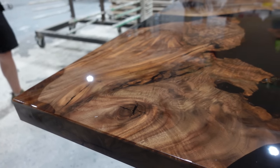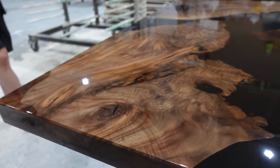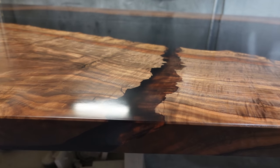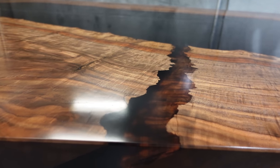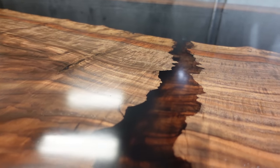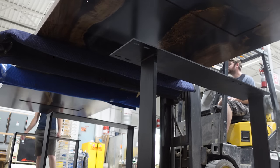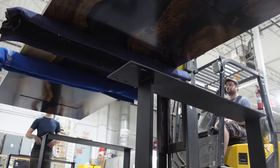But that further increases the durability, it gives a hydrophobic effect, and it does allow you to do a little bit of maintenance on the polyurethane where you can't usually if you don't have the ceramic. By having that ceramic on top, you can touch up any small abrasions or scratches that do end up happening.